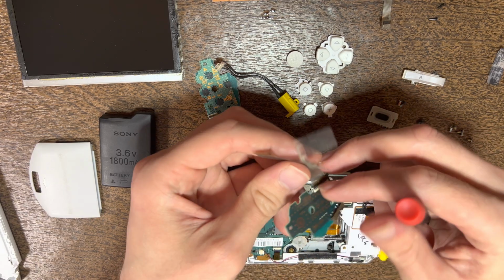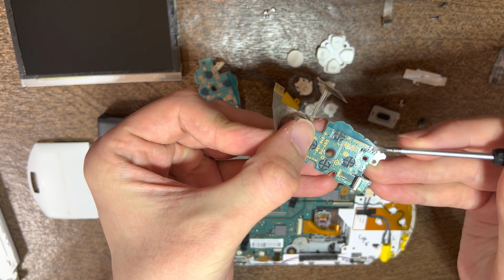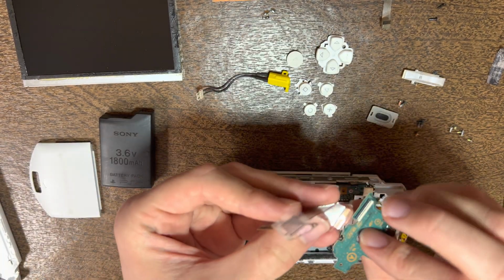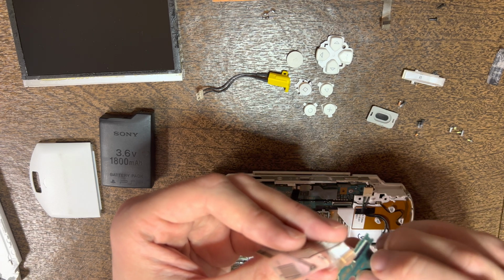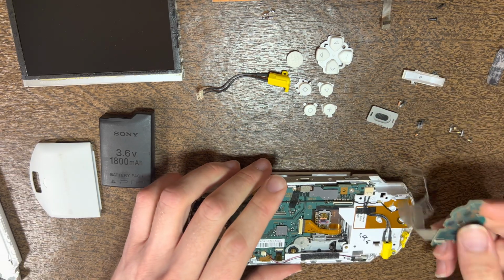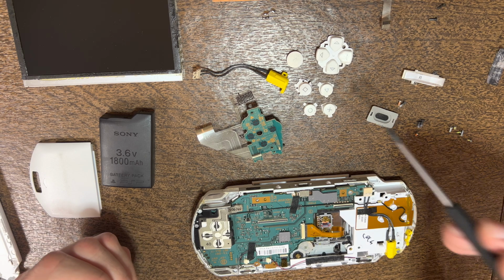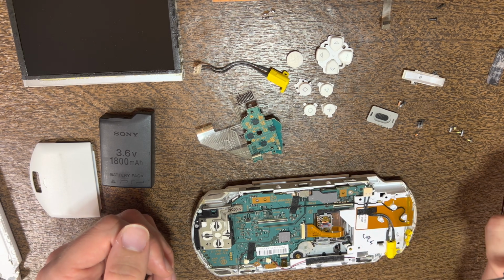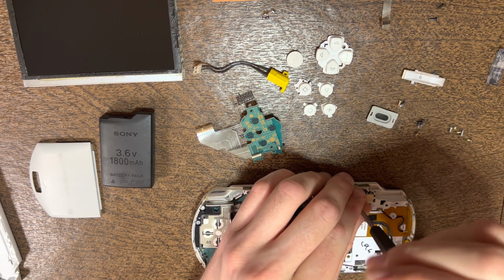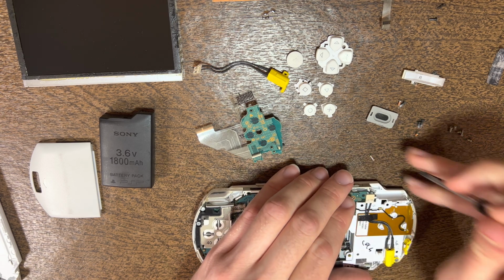peel it off. Then, as you can see on the power switch, we do have a busted area right here. So that's for sure going to fix the problem by just swapping in a new power switch. Power switches, for an OEM used part on eBay, would be about $9, I think. For an OEM charge port, I think it's around $7. You can go generic. Generic would probably be fine for the charge port. Not sure about the power switch, but that would probably also be fine.